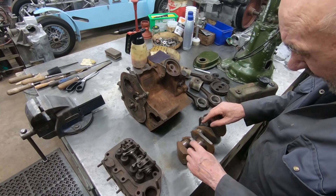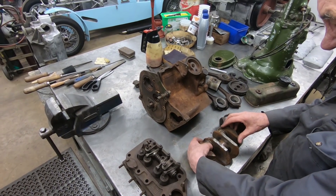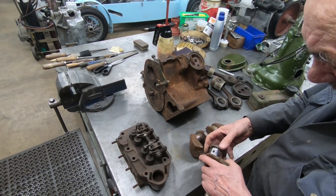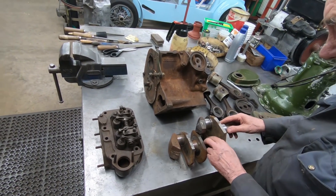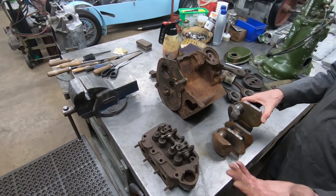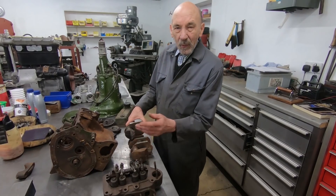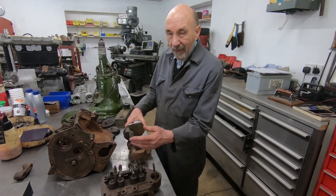What I intend to do is get another Mini crank, turn it off, and spigot the other crank around there — so those big ends will be like that. Then this bit, we'd either spigot it or bore it out and fit it to that, giving us the front half and the rear half. We couldn't find the rear half but it's definitely there, so we might wind up using a couple of cranks. If it's all a bit wobbly, we could have it ground and have the centres corrected, although I don't think that would probably be necessary.